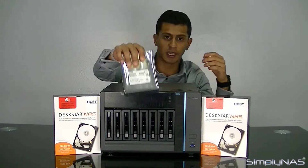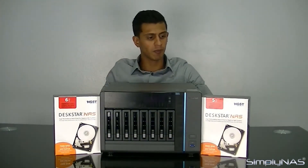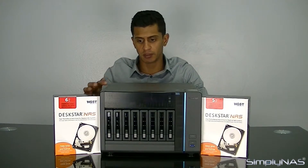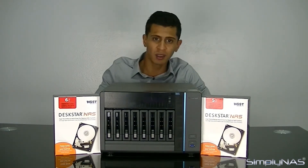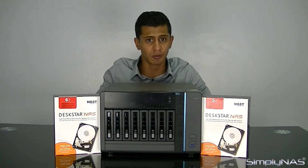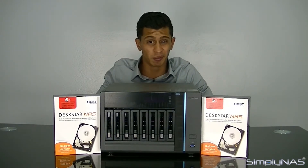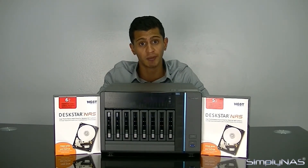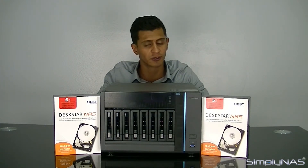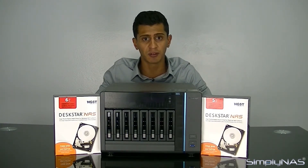Typically, we recommend installing with the HGST Ultra Star drives — these are your enterprise drives. We've found the HGST Ultra Star drives to be one of the more reliable drives in the industry at the moment, available in 2TB, 3TB, 4TB, 5TB, 6TB, or 8TB. 8TB drives are fine, but they're very new, so we recommend them only for archive purposes for now. I'd give them a couple more months on the marketplace to figure out all the firmware kinks — doing firmware upgrades on drives is not fun, especially once everything is installed in the NAS, as you have to let the RAID rebuild every time you upgrade a drive's firmware. At the moment, 5-6TB is probably the best sweet spot if you need big data.